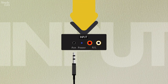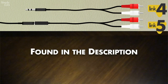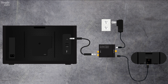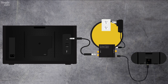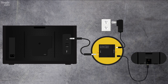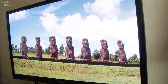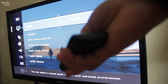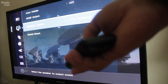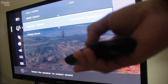If the converter only has RCA ports, pick up an adapter accordingly. Now turn everything on — your TV, make sure all volume sources are up, and that the converter is on (a light will typically come on when it gets plugged in). If you don't immediately get sound through your external speakers, go into your TV's audio settings to select that. Each brand has different terminology, but look for something regarding audio output.